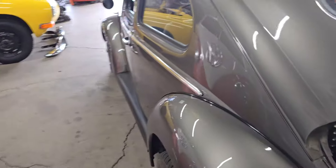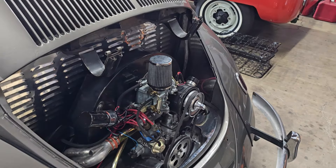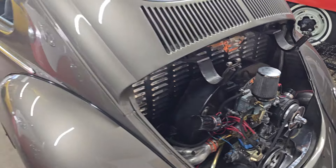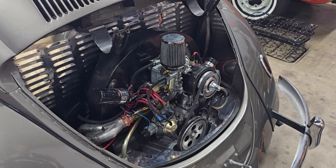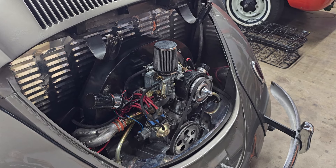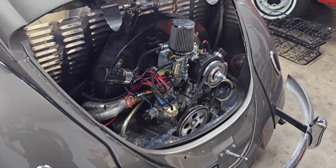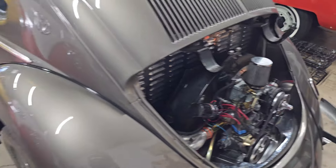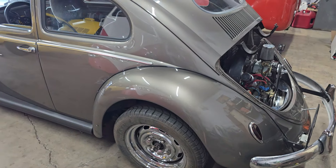In the meantime, we bled the brakes and got the car back roadworthy. Checked the timing — timing was fine. Messed around with the carburetor a little bit, got it running and idling better. Took it for a test drive. The motor is a 1641, a little bigger than a stock 1600, with a cam — bigger than stock — and a small header on it. This thing rips actually, it's a pretty peppy little 1641. I was impressed at how it runs. Had a fun little drive, seems to be running fine, stopping fine, all that good stuff.